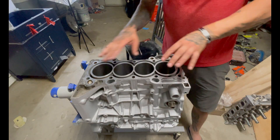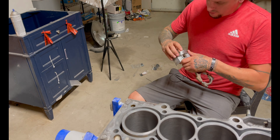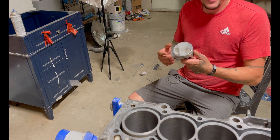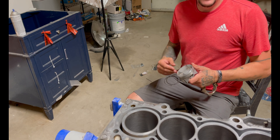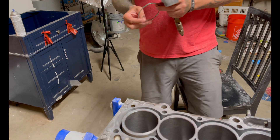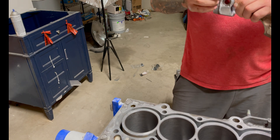I have all my rings gapped out and ready. I'm just going to get all the piston rings mounted up — not in the correct orientation or anything, just on the actual pistons. When we go to press them in these are going to move around. You don't want to set them until you're actually ready to put them into the block. You have your top, your bottom, and then your oil rings, which don't make that big of a difference with the gap.